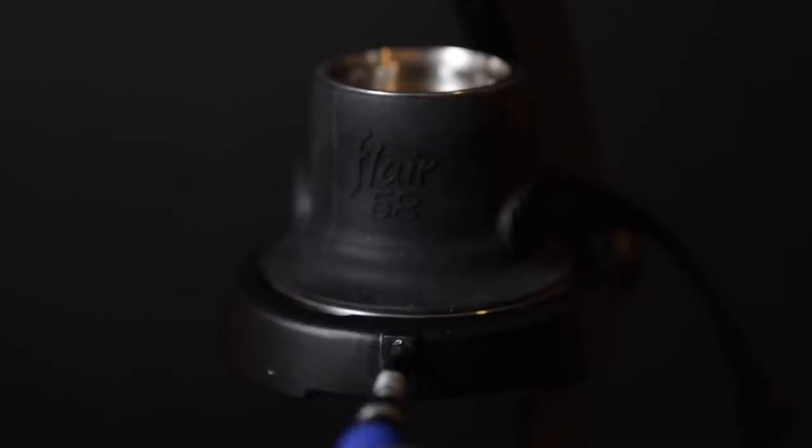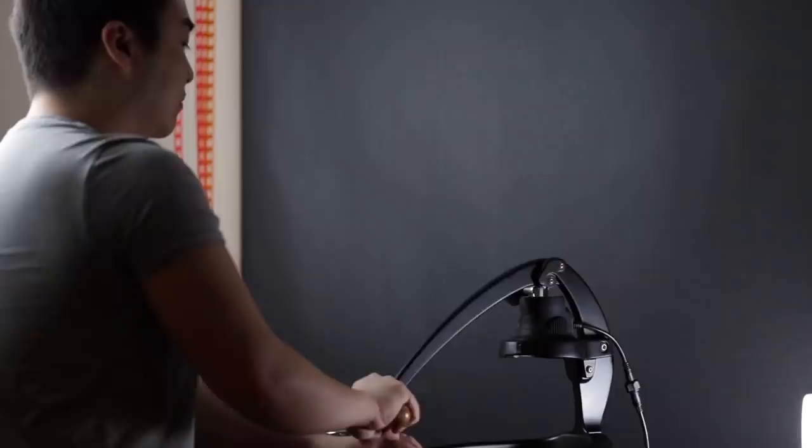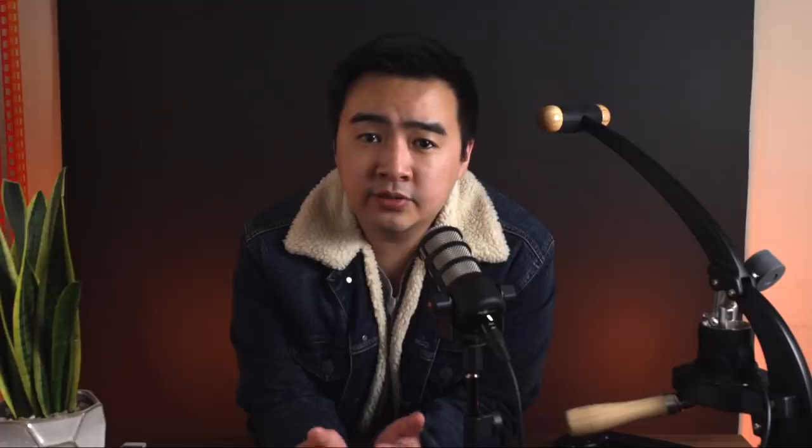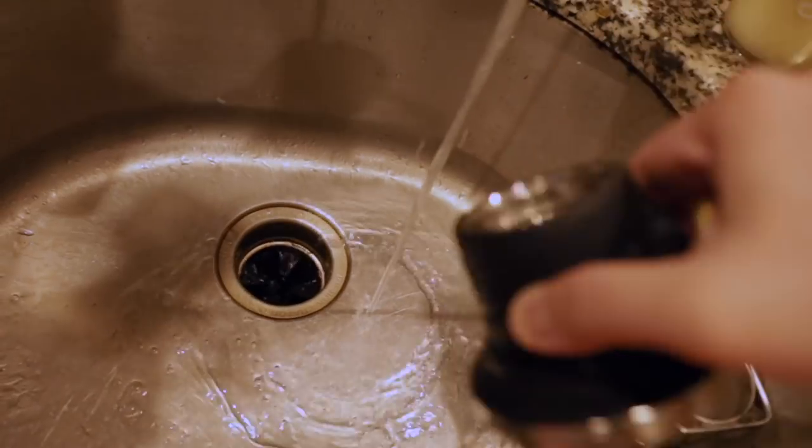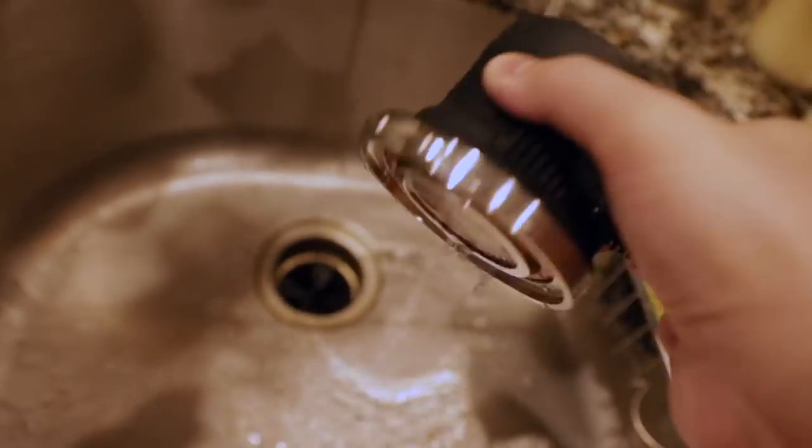Cleaning on this machine is pretty easy. The only exception is that if you tend to lock in portafilters pretty tight, you'll want to keep an Allen key handy to unlock the group. Once that part is done, it's easy to clean. I found you don't really need to clean that frequently depending on how you're using the Flair. As long as you don't pull the lever up too much immediately after a shot, you won't get too much of the grounds pulled through the screen — even less so if you're using a puck screen. I went nearly the entire month before taking it apart to clean, just to see how easy it would be. Once the group head is removed, all you have to do is give it a thorough rinse, and maybe toss in some Cafiza if you really want to clear out any coffee oils or residue.